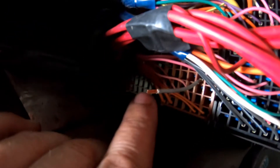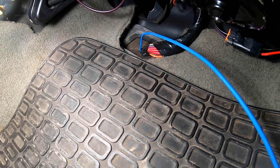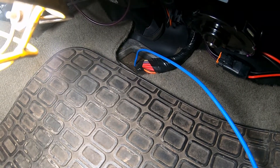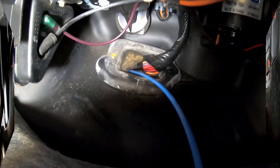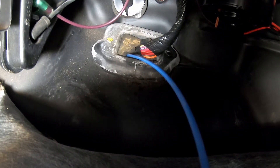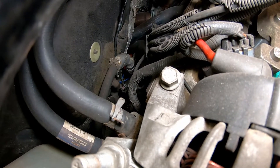The gray wire is cut. I'm going to show you where I'm at with the blue wire now. This is the new heavier gauge wire supplied in the ZZP kit. Right on the floor up here there's a wire connector going through and I'm just trying to push my wire through with it. I drilled a hole in the boot right over there. I got it through the boot — it's going out into the firewall, was not easy, was not fun. Still got to feed it up through to the fuse box.